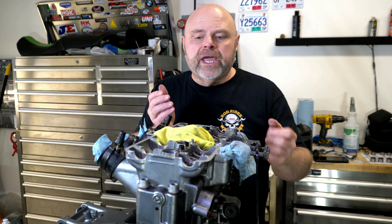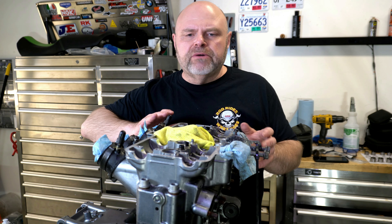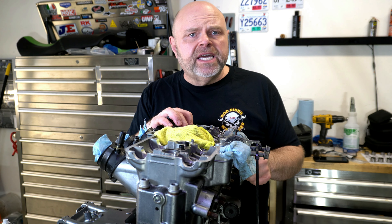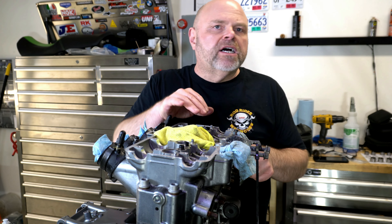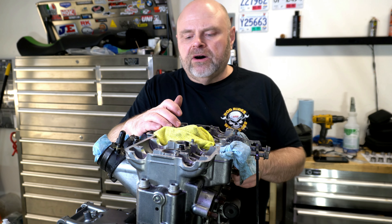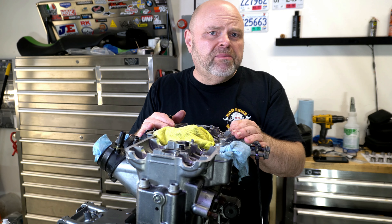The new shims have arrived and we're ready to put it back together. This motor was kind of just on the cusp of needing a shim adjustment at a little over 20,000 kilometers. The only cylinder that was maybe a little bit of a concern was number one on the left side of the engine — on the intake side the valves were very tight and they were also shimmed quite unusually, with a lot bigger shims put into place particularly on the first intake. All of the exhausts are going to get a little bit of an adjustment. The only one that really remains the same is the intake on cylinder number two. Everything else is just going to get a little bit of an adjustment and we'll put the engine back together.